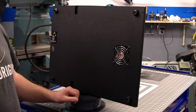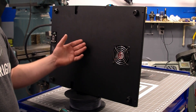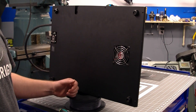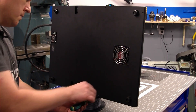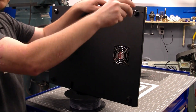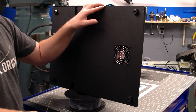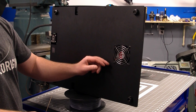The cover is held down with six screws. If you are worried about damaging your anti-tamper sticker, don't worry — you can just remove the front four screws and the cover is flexible enough to gain access to get the job done. I've already removed my anti-tamper sticker so I'm going to remove the entire cover. If you're completely removing the cover, be careful when taking out the last screw to not drop the cover so you don't break the wires going to the fan or break the connector off of the mainboard that the fan plugs into.